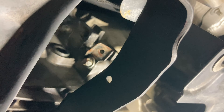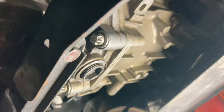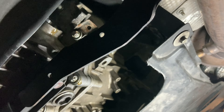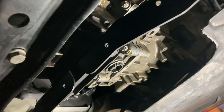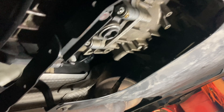Underneath here you'll find a drain plug and right there you can see the fill plug. I'm working in a kind of tight space, so I'm going to get the fill plug undone first and then drain the fluid — always make sure your fill plug can come undone first. When it's out, a little bit of fluid came out, which is to be expected. I actually raised the car up a little more in the front so it was a little uneven. Now I'm going to undo the drain bolt.